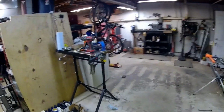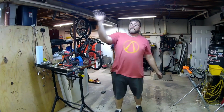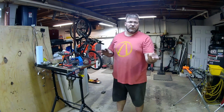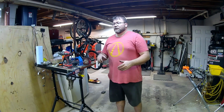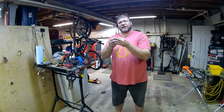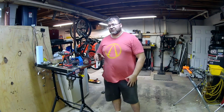All right. I just got the cradle bolts in. The driver's side rear one's a little wonky. The cradle that's in the car is kind of tore up, but it's an 88 cradle. So I really think I need to use a come along and pull. If you're familiar with 88s, you know that rear pocket or tower that the bolt goes through into the cradle. I think it's pushed out a little bit, so I need to pull it back in because the bolt is not lining up quite right. And I don't want to just keep wallowing out the hole. So we've got to figure out how to pull that rear portion of the cradle in. But yeah, let's get back to it.